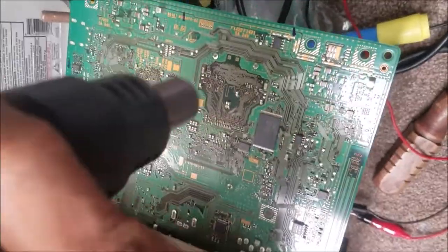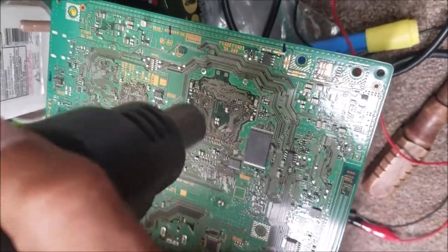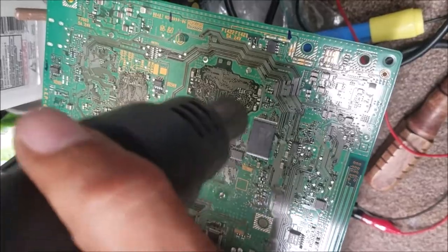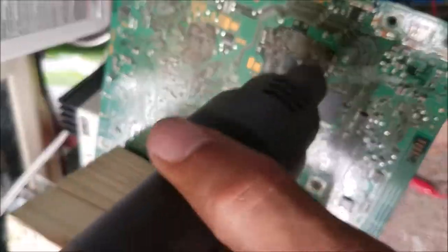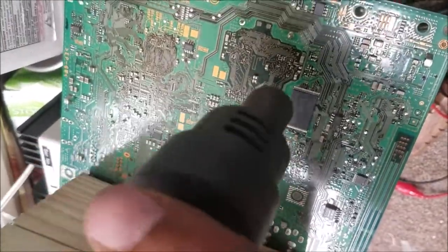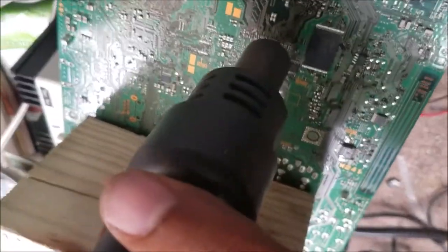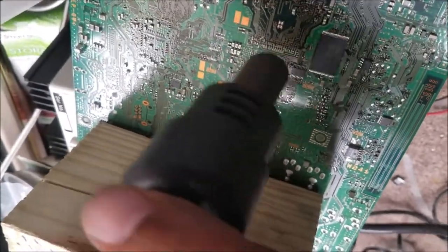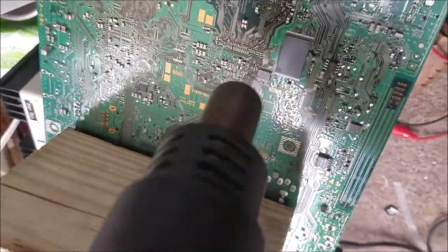Let's go like this for three to five minutes, keep turning. I'm not going to remove the heat sink — that's over there. Just keep reflowing. We test it, if it's not fixed we reflow the other chip over there, then we test it again.